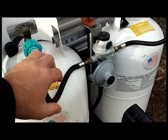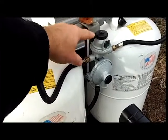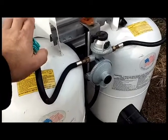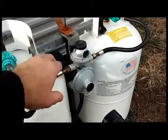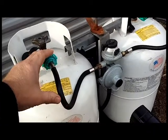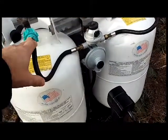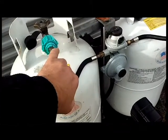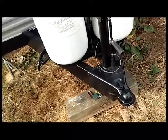What was happening with the old one is pretty cruddy. The tank selector wasn't working very well. If I had it pointed to one tank and that one went empty, it wasn't automatically switching over to the tank that had propane in it. Also the pigtails had to be replaced — they're old style and didn't have a one-way valve in them. They would actually leak propane from the full tank over to the empty tank very slowly. So I changed this out. It was a lot easier than I thought, and I'm happy I did that. I also painted the tongue of the frame here — spruced it up.